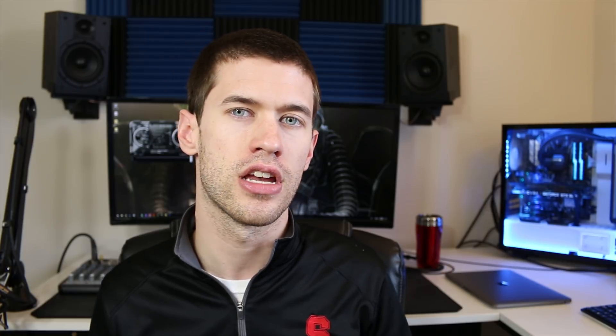For this particular processor, after running about a 40-minute stress test on both the CPU and GPU in the same closed chassis, we saw that without replacing any stock thermal paste or thermal interface material under the IHS, temperatures were in roughly the mid 70s. Once we switched out the thermal paste both on top of and below the IHS with liquid metal, we saw temperatures in the very high 60s or very low 70s — a five to six or seven degree improvement after an extended stress test.